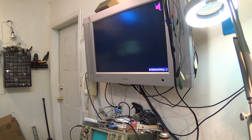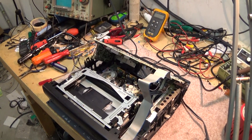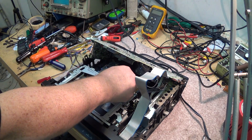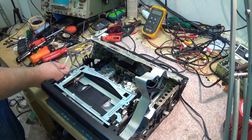So this could be a couple of different things: we could have a bad head, a dirty head, or an electronics problem. The first thing we're going to do is try cleaning the head and see whether that will restore the picture. I'm going to do this using the good old writing paper method — get some writing paper and some solvent. We don't want to use Q-tips — you see people going in there with Q-tips and you're asking for trouble; that's a good way to permanently damage your video heads.